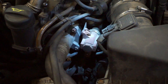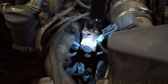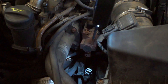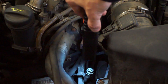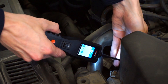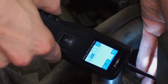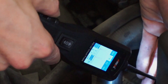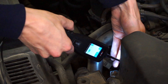Back at the engine there's a vacuum valve over here — this is responsible for controlling the variable geometry turbine in the Volvo 2.0 diesel engine. Here's the connector I just disconnected from this valve. I'm going to turn on the ignition and check what signals are going through this connector to the valve. This is how the signal looks: we have a 250 Hz frequency, give or take, and pulses that will control the vacuum valve.